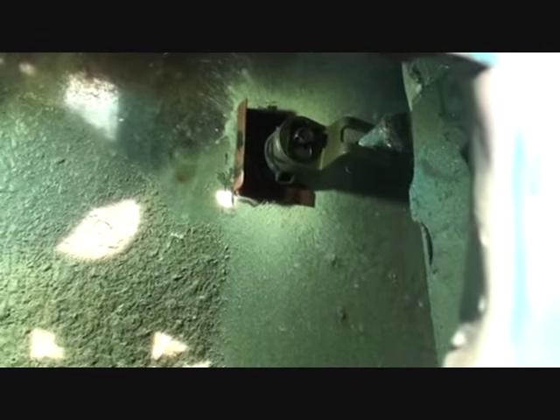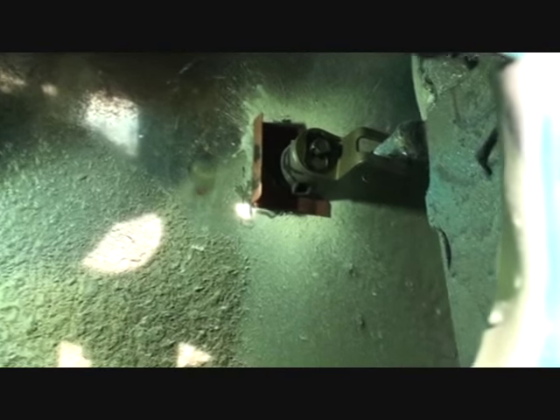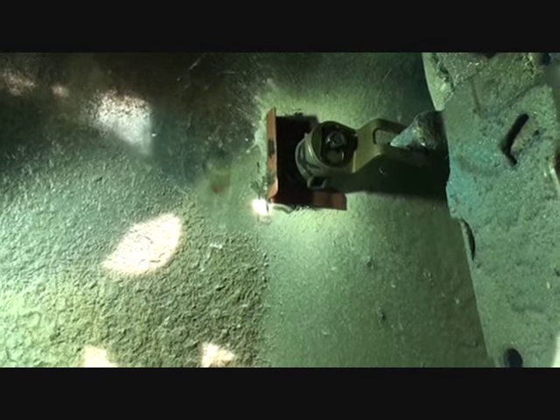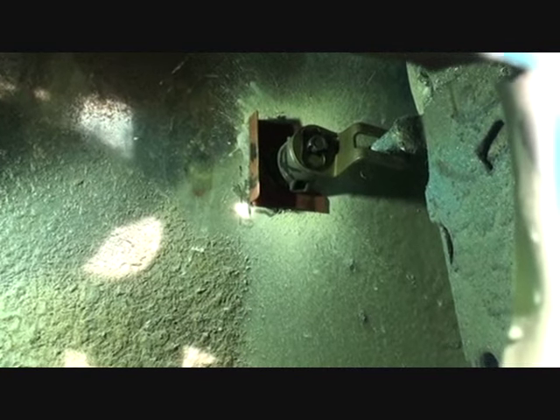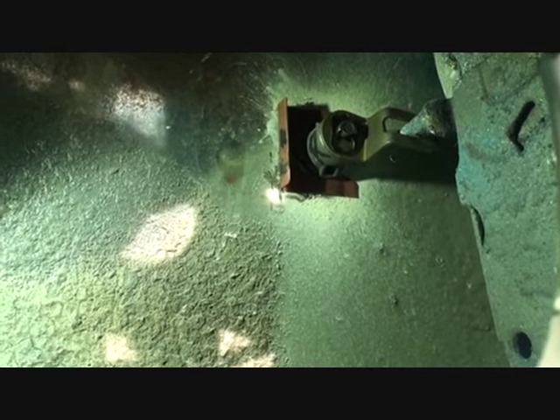There's also one other thing I want to check, and that is the exterior lock. When you put those in, there's actually a little pin that sticks out and the lock slides around that pin so it'll move up and down. When I put the lock on I didn't pay attention to see if it went on that little pin or not. If you look at the lock right there, you can see that the little arm did go over the pin. That's something you really got to pay attention to, because if it's not lined up properly you'll miss that pin and have to take the whole door apart. At least we got lucky with that situation.